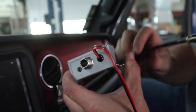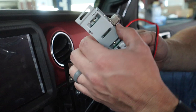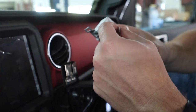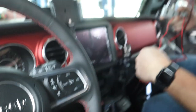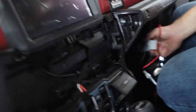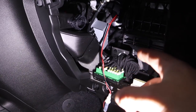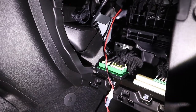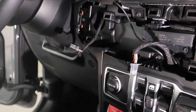The cool thing with this CB radio is it's a remote. So everything's in the actual handheld mic — it's an all-in-one unit and this is the remote. This is where the antenna goes into, and the CB plugs into this. We're going to wire it by splicing into our DC power port right here. We're going to put this behind the glove box. It's very easy to remove the glove box. That's the remote unit right there — probably going to zip tie it in there. There's a lot of room. Then we're going to run that power wire over to the DC power port where we're going to splice it in — it's going to be a nice, clean setup. Tracy's still running the entire wire to the front of the Jeep cab, running along the trim panel all the way up to behind the glove box.